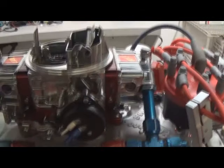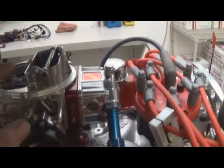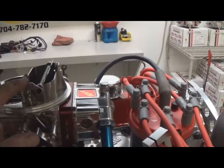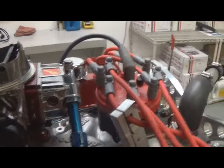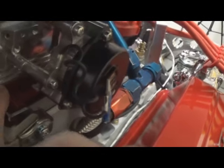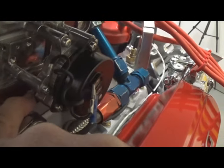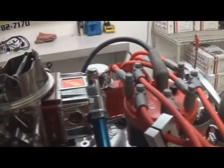Basically you've got two functions here. One is the choke pod, which controls the choke blade — where it's positioned when it's cold and how it basically opens. The other adjustment is the fast idle adjustment, which is this little screw down here — kind of like your idle screw on the fast cam, that red cam.